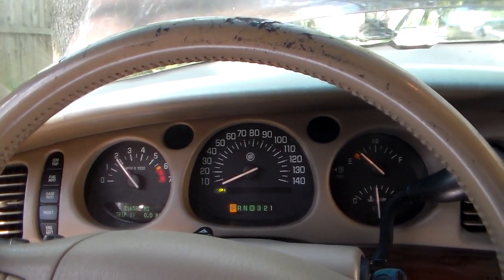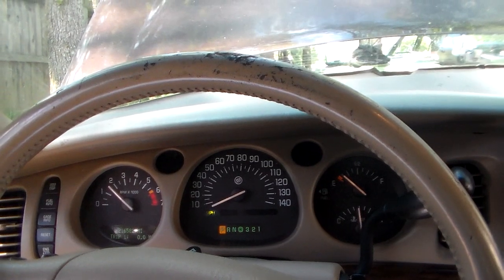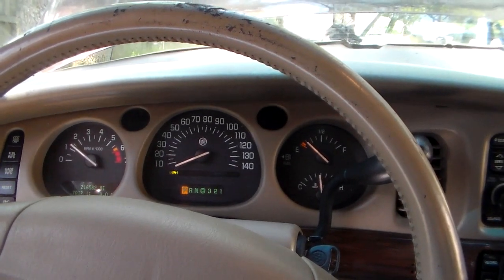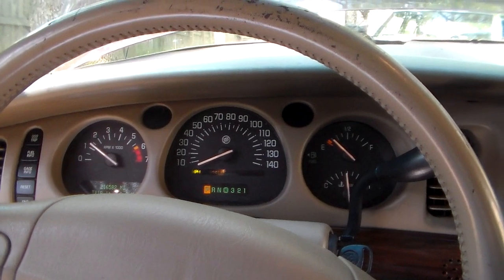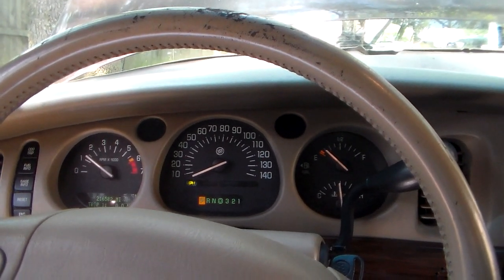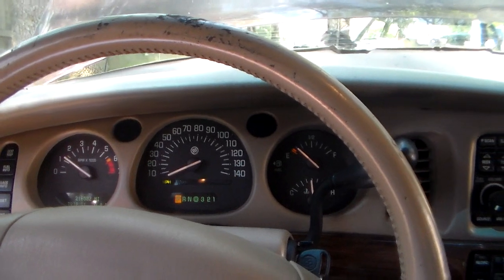Well, that's probably a vacuum leak. So I guess you'll have to do your plenum job again. My what? Your intake plenum job again. My intake plenum job again? Yeah. You probably got a vacuum leak somewhere up there. See, it runs good once you get off idle. It's running okay, or seems to be, but it threw that code up for a P0171. Why in the hell won't it run right? I don't know, bud.